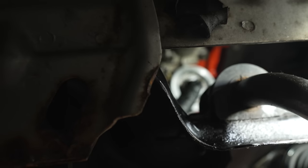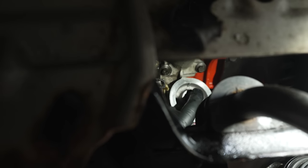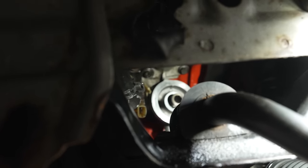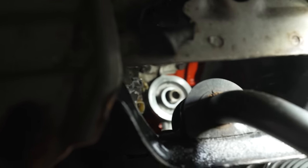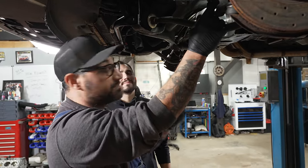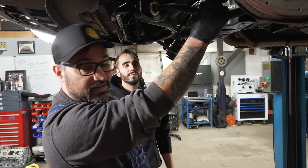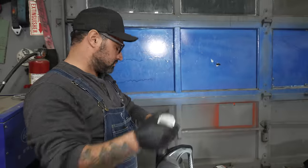And then I'm gonna come in here with a little hand sprayer and pump as much oil as I can through the motor, trying to get it into the camshafts and into the main bearings, the rod bearings, absolutely everywhere that oil goes, just so that this thing is nice and happy when it gets fired up. And hopefully we can fire this thing up, have oil pressure right off the bat, and be ready to throw a ton of boost at this thing. But the first big win we're going for in this episode is proper oil pressure out of a 4.6 on startup. So let's do it.